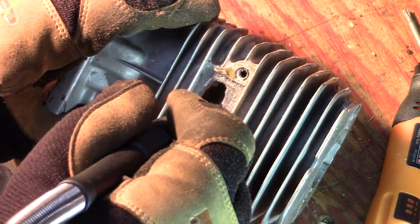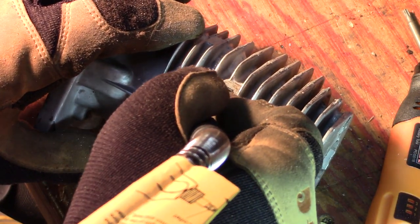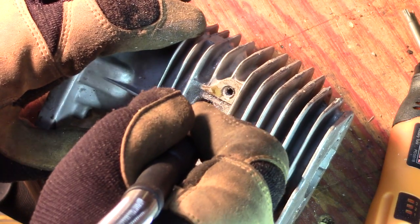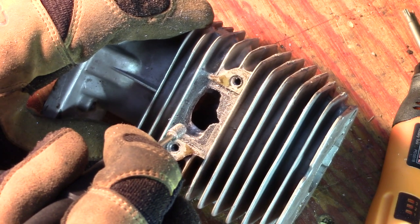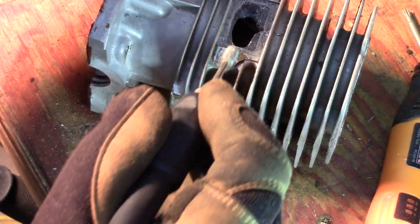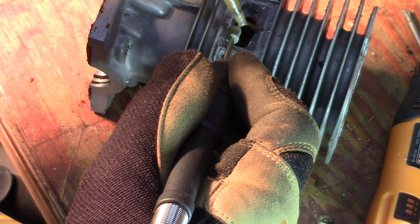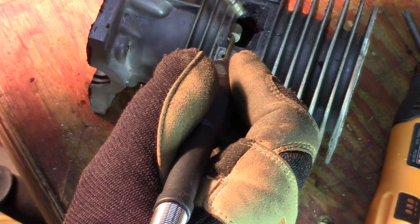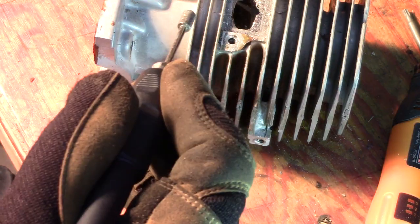I'm going to be going in like this and coming out, doing strokes from inside out, inside out, and then smoothing it out. Whenever I go into the bore I want to be on a little bit of an angle to make sure I'm not pushing that chrome liner out and chipping it. Take your time, and also use some cutting oil every once in a while — it'll get the debris away and also keep the tip cooler. All right, so here I'll start up some of this and you guys can see how it works.